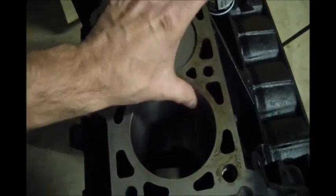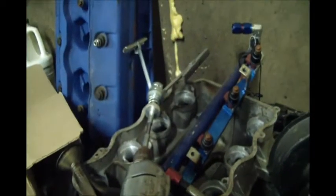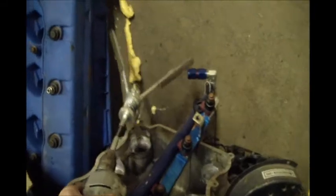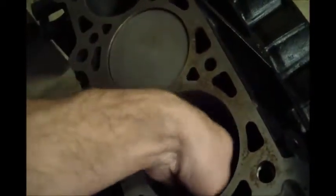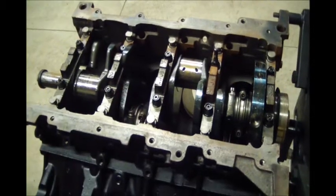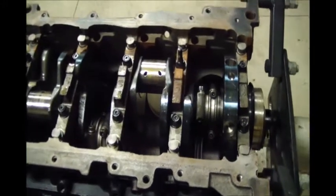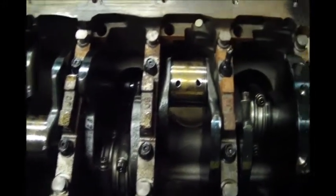I spent literally probably 15 seconds of just feathering this old drill with just a 3-blade deglazer. They call them hones, they're really deglazers. And I ran the full length of the bore to make sure I didn't screw the cross hatching up. I could still feel a little grit in there, so I'm gonna have to clean that grit out. But now that I'm happy with the bores, I know they'll clean up just fine.